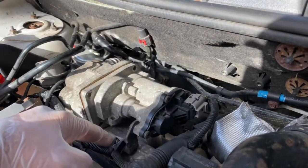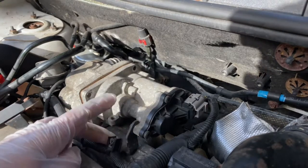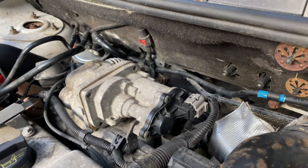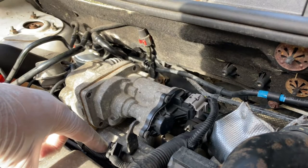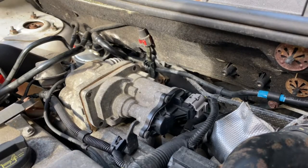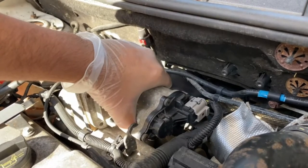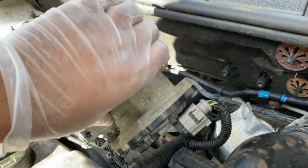Yeah, and then just take this bolt out over here, just connecting it to whatever this thing is. And if I'm not mistaken, it's two sizes smaller, so it's a T25 torque bit. Yeah. So you can just break it loose because it'll be a bit tight, and then just use your fingers to gently take it out so you don't mess the threads up. So let's just take this out now gently. There you go. Slowly take it out. Just put it to one side for now.